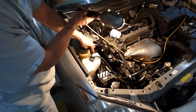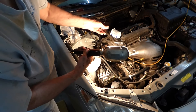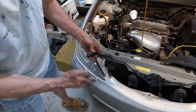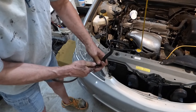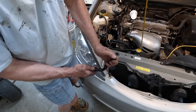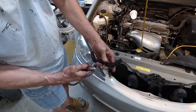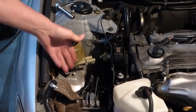It may be that all I need is a tighter clamp up here on the reservoir. This hose looks pretty good to me. I'm going to put some pressure on this hose and see if I can find a leak — just push it on my air gun here. I can't hardly hold my thumb on that. I don't think we've got a leak in the hose. I think I just need some good clamps. I cannot find a leak; I don't see a crack anywhere. But it was definitely leaking — it was a mess there.